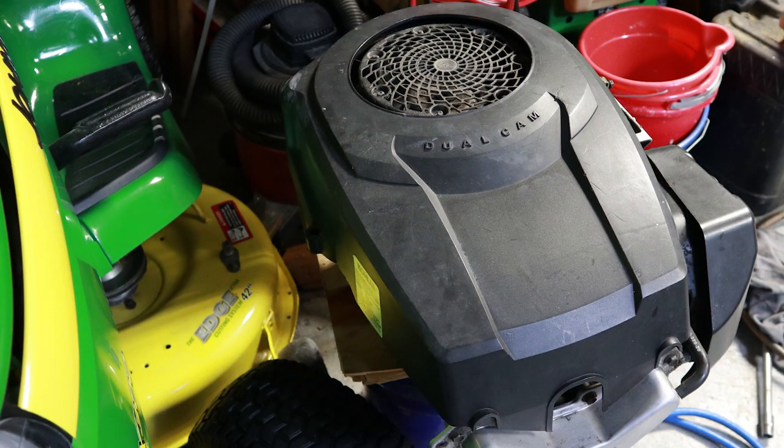Chances are at least one of them is loose. I'd recommend you back them all out one at a time, apply a little bit of blue Loctite, let it run down into the threads, and then retighten them. Fortunately, I've got another Kohler Courage motor sitting here that I've had in my shop for years to replace it with. Hopefully shaft sizes, length, and diameter are all the same. Anyways, let's get started here and get this engine swapped out.